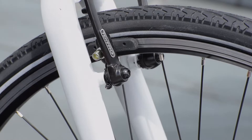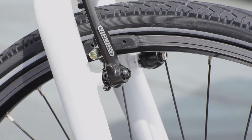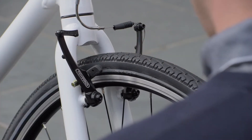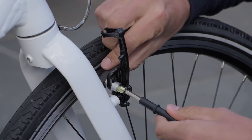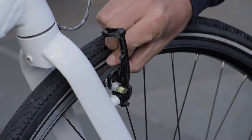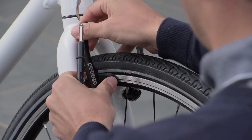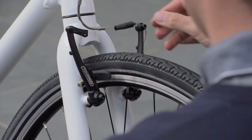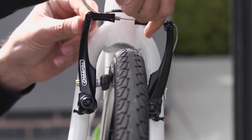Last of all, let's look at how to align and replace the pads. For your brakes to perform at their optimum, the brake pads need to be correctly aligned against the wheel rim. Firstly, disconnect the brake by closing the brake arms with your thumb and finger, allowing you to lift out the cable. Then use your GTEC tool to loosen the brake pad fixing bolts, allowing you to adjust the position of the pad. You can both straighten the pad and adjust its height to make sure it rests perfectly on the wheel rim when the brake arms are closed. When it does, hold the pad securely in position while you retighten the brake pad fixing bolts. Then reattach the cable by pinching the brake arms closed and slotting the cable back into place.